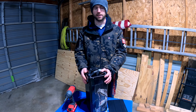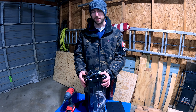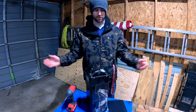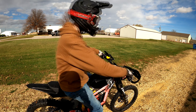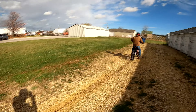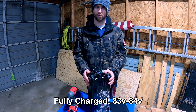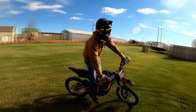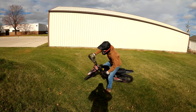One of my biggest pet peeves with the 72 volt pack is that it doesn't have a percentage display on the pack — all the stock batteries have one. You could argue that aftermarket controllers show voltage, but that opens up a lot of guessing. A 72 volt pack doesn't sit at 72 volts constantly: fully charged it's around 83–84 volts, fully discharged it's around 60–61 volts. You'll be guessing a lot about remaining range in between those numbers.